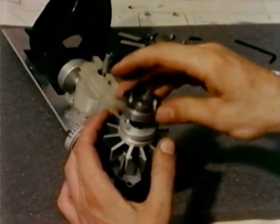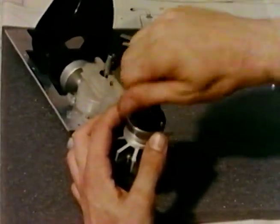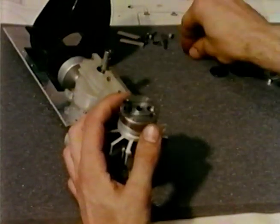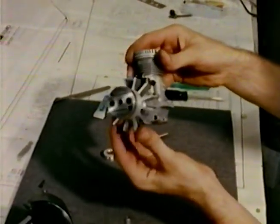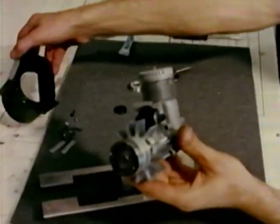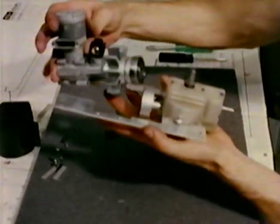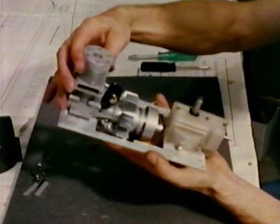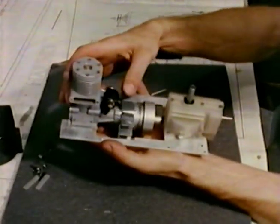The motor and main gear are connected by this centrifugal clutch. This type of clutch makes starting easy, as the transmission is not engaged while starting procedures take place. The clutch is self-enclosed and requires no servicing. At 3,500 RPM, it softly engages the motor and transmission, and as RPM is increased, continues functioning without slipping.